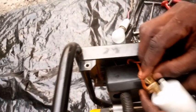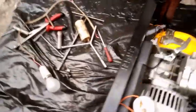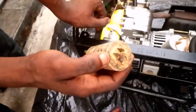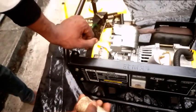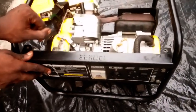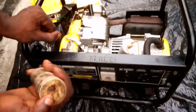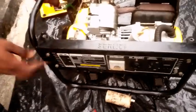There are four points here — you can fix the capacitor any way you want but I like fixing it at alternate points. I've succeeded in fitting the new capacitor. This old capacitor looks dead. We are physically examining it without instruments, just in case it happens and you don't have any testing equipment with you. You can just physically examine it — and this one looks bad.